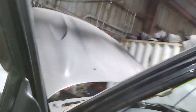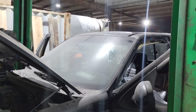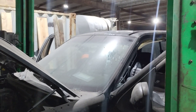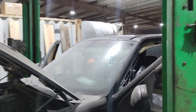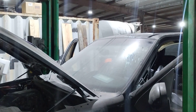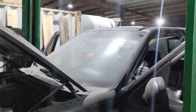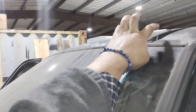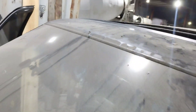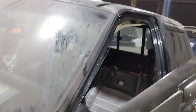There is another possibility for a water leak on this truck and that would be the windshield. With age, the silicone they use to attach the windshield onto the body rots. You have water that gets in between the seal and the body and it rots everything. As you can see, the owner of the truck attempted to put silicone throughout to try and prevent it from leaking, but that obviously wasn't the issue.